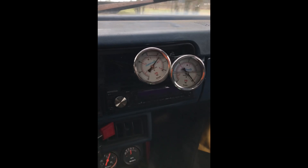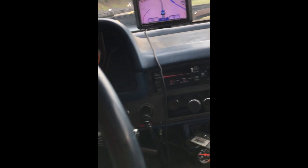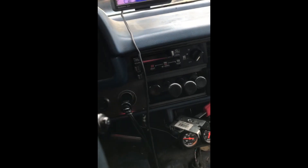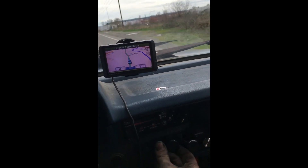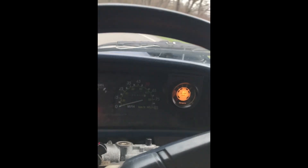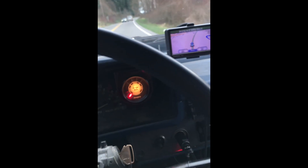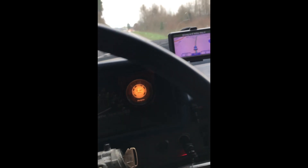And we're back to cruising on wood, cruising about 40. Backing is about 3 to 1 — it's a little bit too tight to put too many fines in the char bed. I'll do a quick switch back to gasoline and show you guys what it's like to switch back to wood — you know, when I've got to climb a big nasty hill, I'll switch over to gasoline for a little bit. Turn the fuel pump on — it's going to start running rich, there it is. Pull out the air valve, close down the wood, back on gasoline. Now to switch back to wood gas — wood gas open. We're going to wait for it to start running out of gasoline. There it goes, it's starting to run out.